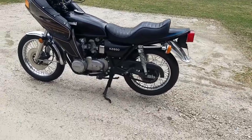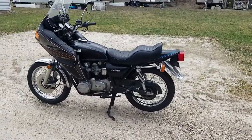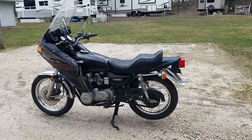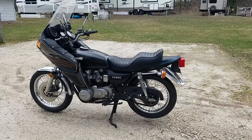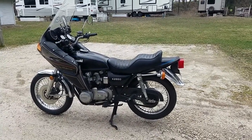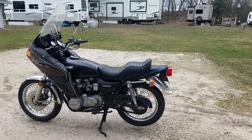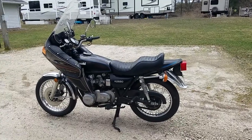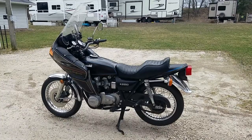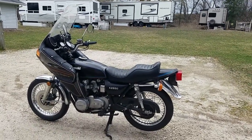All right, Ryan. So we just went through the bike, put a new front tire, new rear tire, as well as new inner tubes. I like to do new inner tubes on everything. It's your tires. It's what connects you to the road, and you have a bad inner tube, and that can wreck your day. Got rid of the old points and condenser, went with an electronic ignition, rebuilt the front brake master cylinder, flushed that out with some fresh brake fluid. We replaced the lock cylinder in that better hard bag cover.